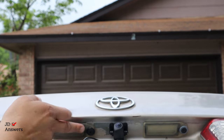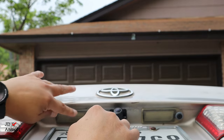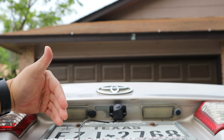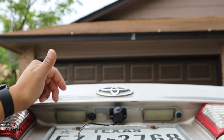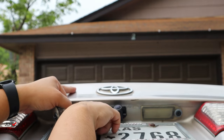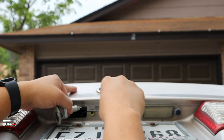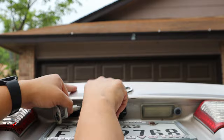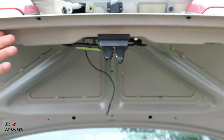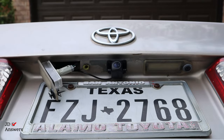The way I route the wires is I utilize the license plate light. When I take this off — you take this thing off here — then you can route the wire to the inside of the vehicle. You can see the wire harness here and I can simply push the wire inside like this. You can see the wire just dangling right here, so all we've got to do now is push the light back in. That's how easy this installation is.